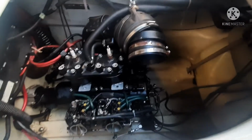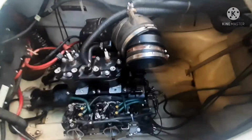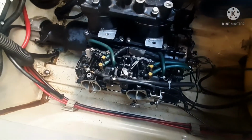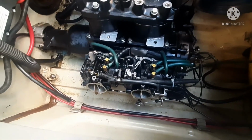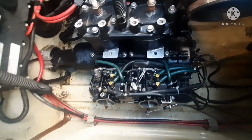And I always finish up, tighten the boots. That's where I finish, that boot and then the back boot. And that's the easiest way to get to your carburetor. Of course, it's 4 10 millimeters and 2 Allens in the center to pull the carb, and of course all of the lines and hoses.